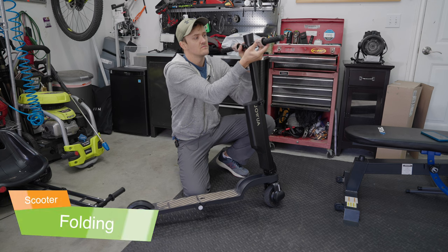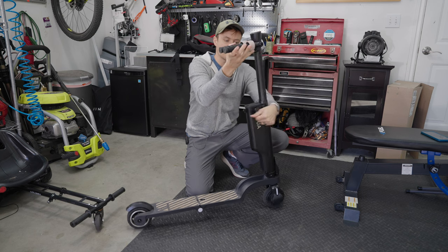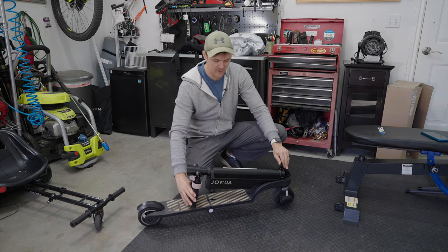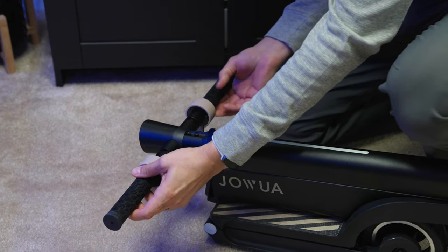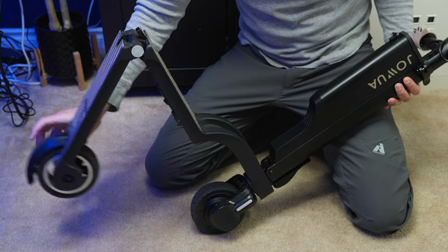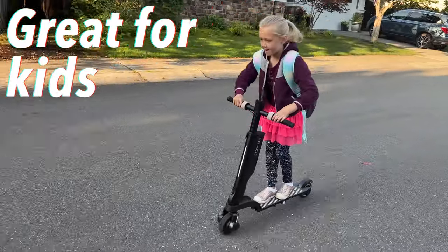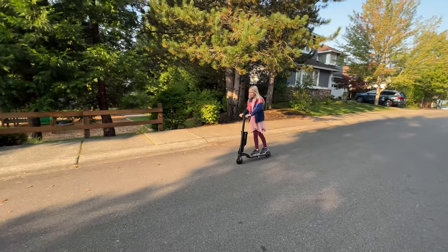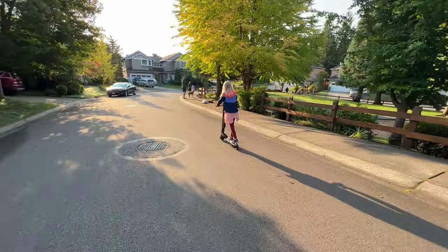The scooter folds down into four sections. First, you fold the handles by sliding over the two metal rings next to the handles. Next, loosen the tube clamp and slide the handle down. Release the folding buckle and fold it in half. Simultaneously release the clip in the middle of the footplate, and it all snaps together. To open the scooter, open up the handles and snap them over the metal rings. Open the footplate by pressing on the foot brake pedal, then raise the tube clamp and tighten it to the desired height. This is really important because if my children were riding it, I could just lower down the handlebars to their height. Then when I want it, it just takes a few seconds and it's back up to my height. That's something you rarely see with electric scooters.